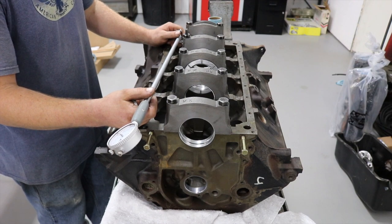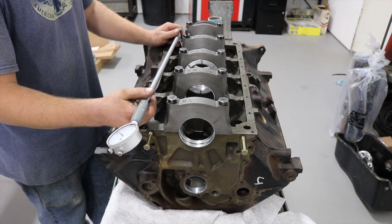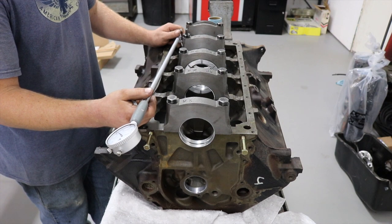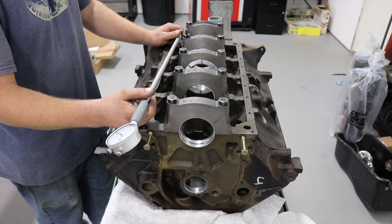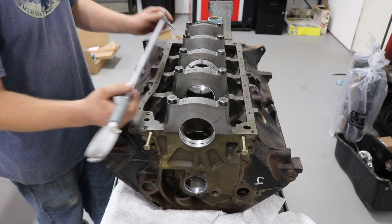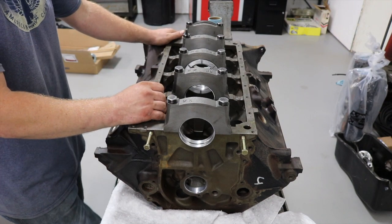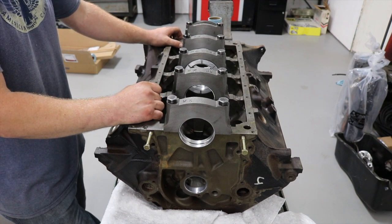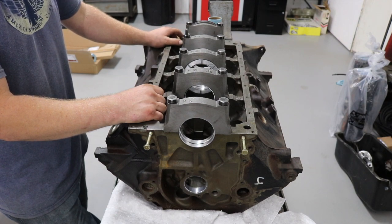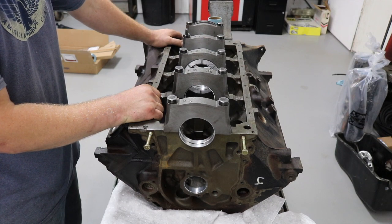I also really don't like aluminum bearings. Anyone who has ever tried to TIG weld aluminum knows it's real sticky, and that's also the case in bearings — if you have journal-to-bearing contact it will smear that bearing real bad, real fast. The stiffness isn't there either, so typically I'd try to run a tri-metal bearing. But this is what was available. I also wasn't able to get standard-diameter King rod bearings, so I have Federal Mogul bearings which I haven't used in probably 10 years. I did have ARP rod bolts pressed into the rods and the rods re-conned to get them to the middle or top of bearing crush spec to open the clearance up — ideally closer to three thousandths on the rods. I'm going to hammer the core plugs in and then get it back in the stand and start measuring rods.